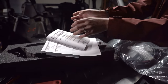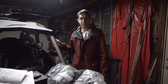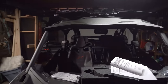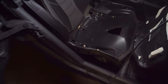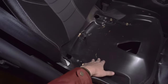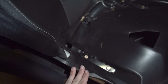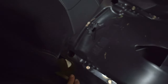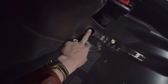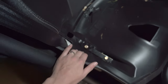We're going to show you how to install the whole kit. The first thing we're going to do is go over here by our buddy John and show you how to remove the back passenger seat. We are at the rear passenger side seat on the X3 and we removed the bottom padding — it's just attached by velcro. You need to use an 8mm socket to gain access to these two holes, so we're going to go through and take those out.